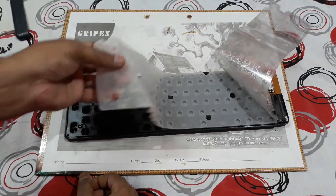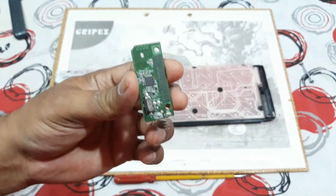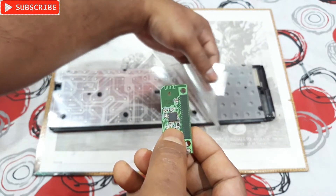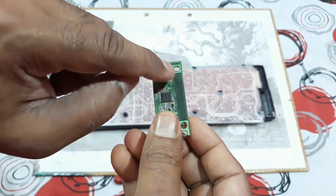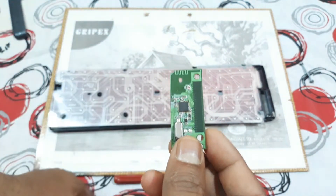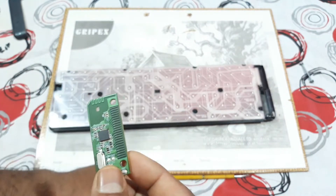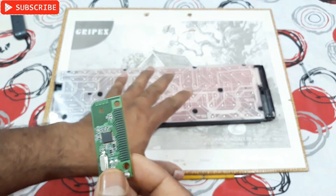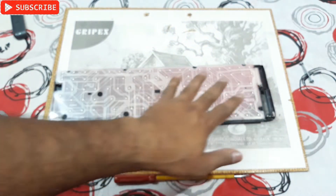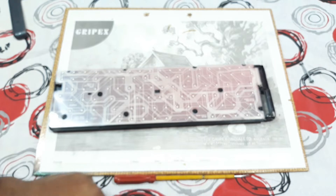We're going to clean these up. This is the button rubber pad — let's remove it. This is the main circuit board, the main controller chip, and all the connections of this film strip. If this controller had a problem the whole keyboard wouldn't work, but since only some keys aren't working, the problem must be within the film circuitry — from dust or maybe water. I'm going to clean the connection lines and the film circuitry with a brush and cleaner solution.